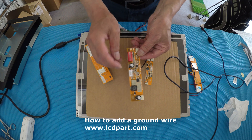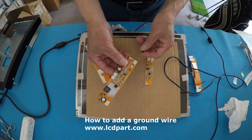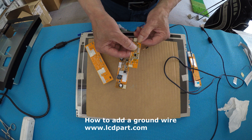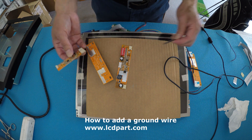Same thing for the 456UB — you see the can capacitor, the negative one which is this side, you solder here. Or for the 456UB you can solder this one too, either way. For the MS610UB, which is for smaller displays, you can use a slightly thinner ground wire, but I would still suggest using 16 gauge or bigger.